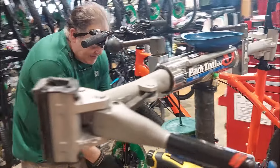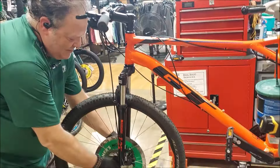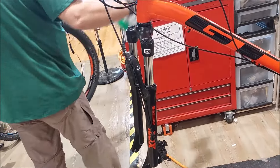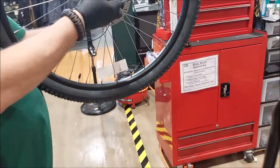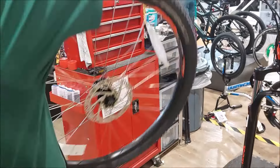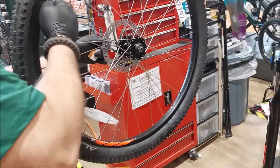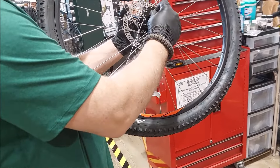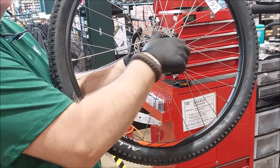So there are about six things on this bike I don't like. Why did you take the tire off? Because the skewer is on backwards. The skewer — also known as the retention rod — is on backwards. I want all my adjustment points on the chain side and all my retention points on the non-chain side. If you consistently do that, life is good.